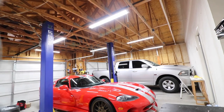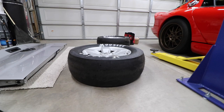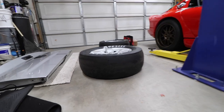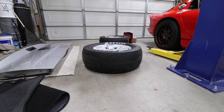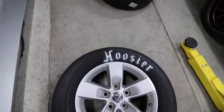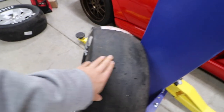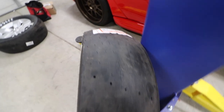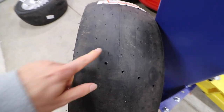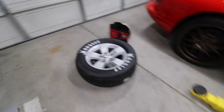Let me show you - this is what they look like, they're mounted now. As far as bulge goes, I heard some people asking whether the rim would be wide enough, so hopefully this answers that question. These are 9-inch rims with a 10-inch wide tire, so there really isn't that much difference - it's not sketchy or anything of that nature. They look normal when you're just looking at them, but right now they have about 30 PSI in them. We wouldn't be running down the strip at that - we'd probably take them down around 20 or so. They're very gummy as you would expect - you can sit there and make a mark in the rubber with your nail. We didn't put any weights on them, but they're mounted - got both of them right there.